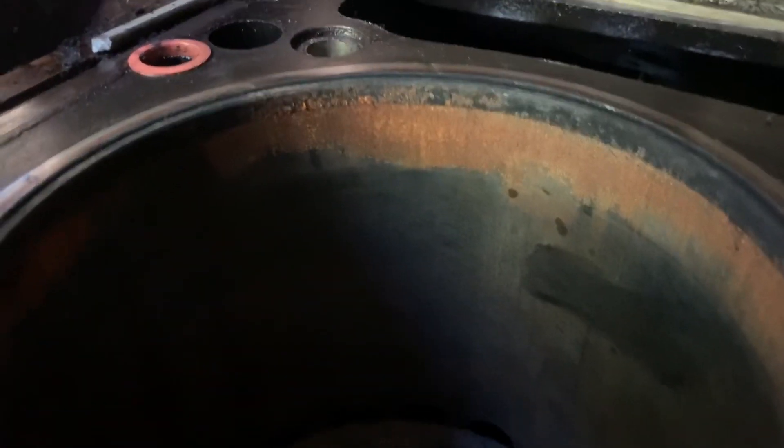Look at all that rust in the cylinder liner. It had to have been one of the ones where the valves were open. There's quite a bit of wear — you can see the top. Although I still see some cross-hatching down in there, there's definitely a groove I can feel at the top where that ring goes.